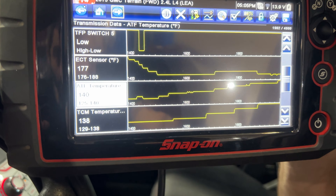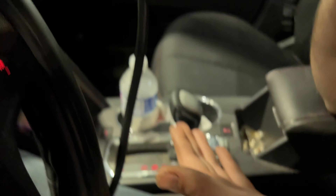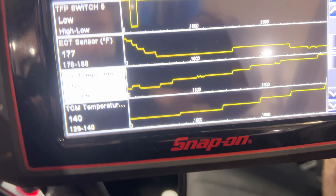It has to be somewhere in that window for the fluid level to be set properly. Right now we're at 140°F. I actually have the vehicle running in the air, put it in manual mode second gear, running it — not really under load right now. You're supposed to drive it around, but this is a similar thing; we're making the temperature rise.